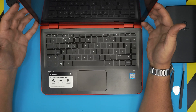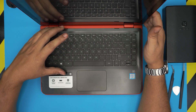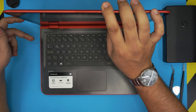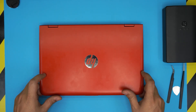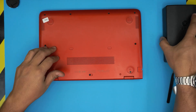For this laptop, I'm going to show you step by step how to open it up and how to upgrade the RAM. It comes with two RAM DIMM slots available. This one has 8GB inside, but you can upgrade it to 16GB with no issue. First, let's go over the tools you'll need.